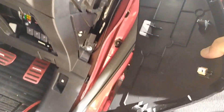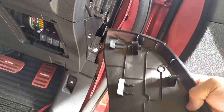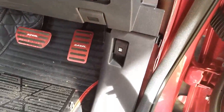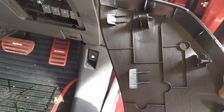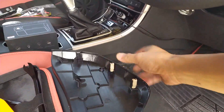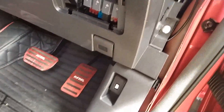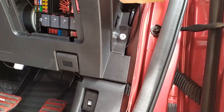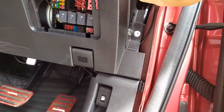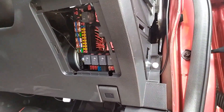The panel is held in by these clips, and some of them have actually come off — that's okay. They'll fall down there into the well; you can just pick them up and pop them back on. This is the one bolt you need to take off, and that'll give you access to just underneath the dash.